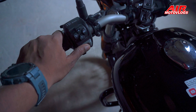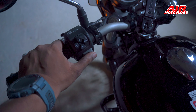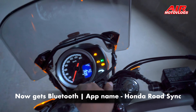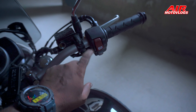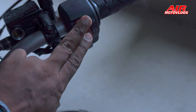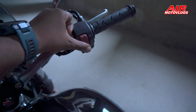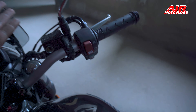If this is not the case, your hand ends up going the wrong way and the switch behaves incorrectly. This thing should have been redesigned. In the newer models, this is integrated differently. You have to press it once, wait a little bit for the FI function to come on — that is the ignition sound. Then you press it again. So once you do this, you have to wait for a few seconds, hear the FI sound, once it completes then you do this and then the bike comes to life.